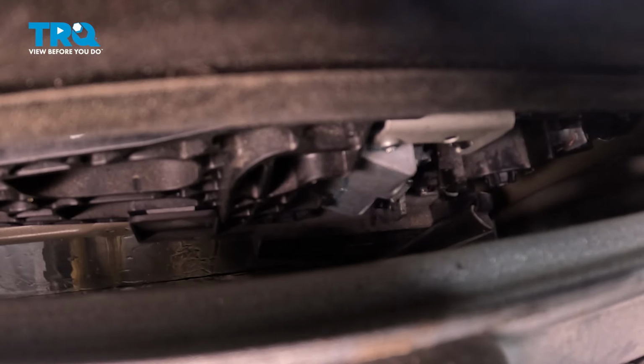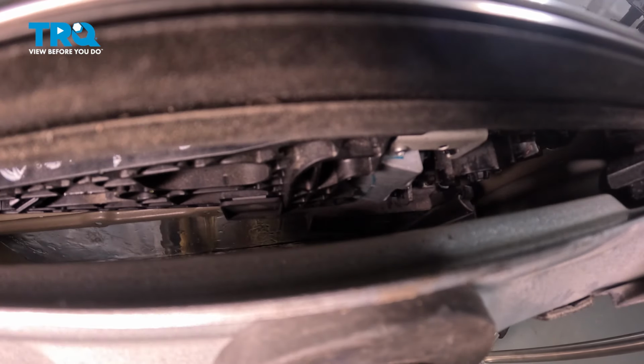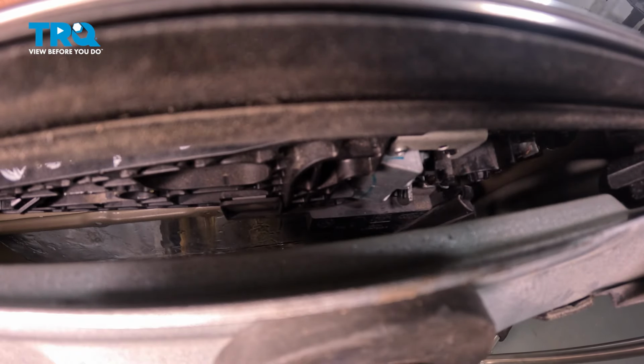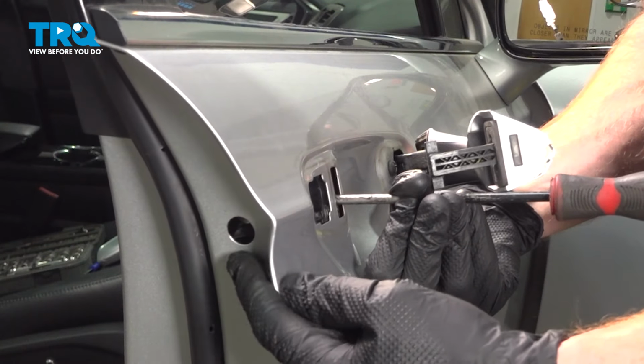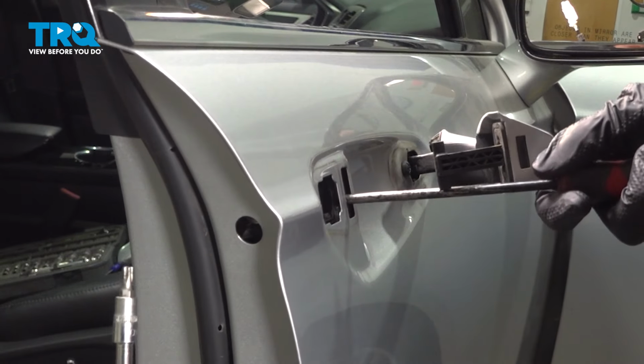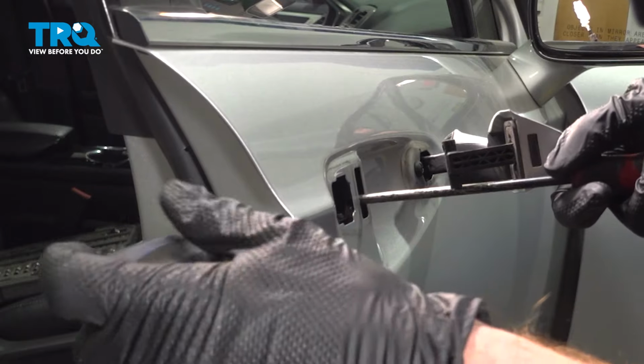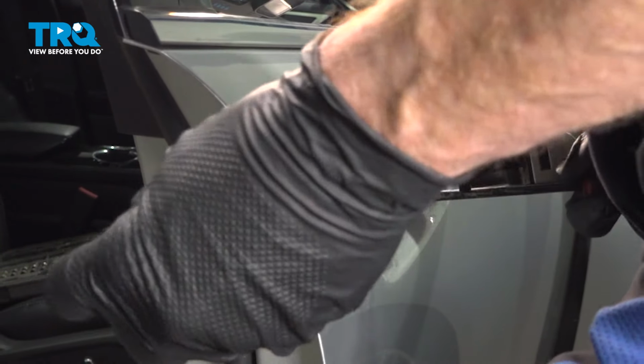Essentially what we need to do with the angled pick is just to grab onto that and pull it towards the outboard side of the door. Now while holding it in this position, we're going to be extremely careful, but continue on the outer screw inside where the door latch would be, on the door jamb side there. In this area, we're going to turn our screw fully clockwise, tightening this, while paying attention on the inside.